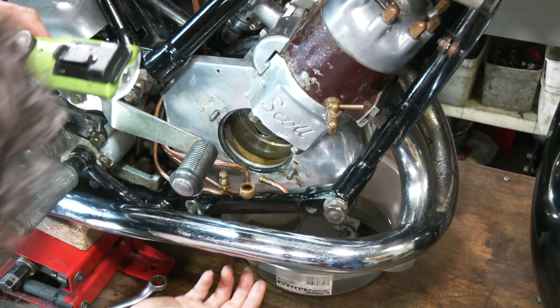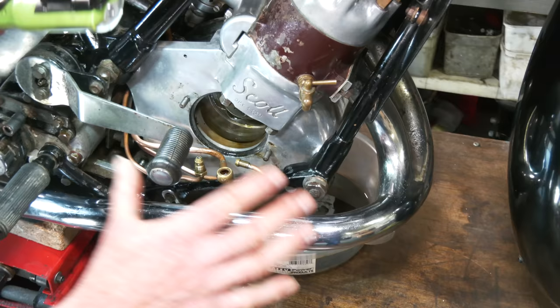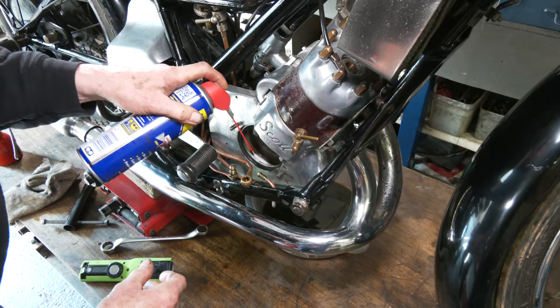What we've done is moved the drain plug from this side of the crankcase — with two crankcases because it's like two separate engines really. And you'll see in the centre there the trough is now empty. So we're just going to make sure there's no debris in the bottom. We'll squirt some stuff in there and blow it out with the airline. We know it's completely clear then.